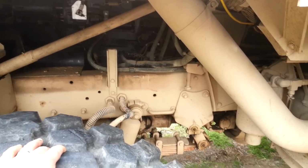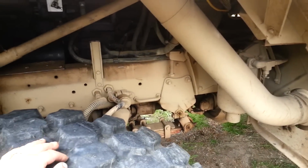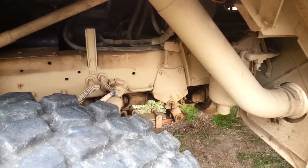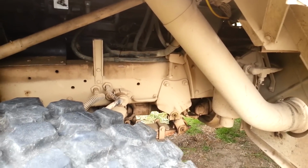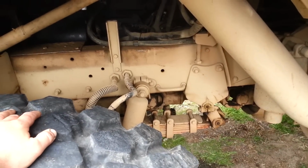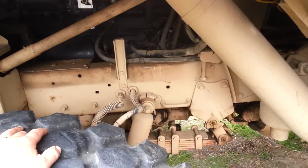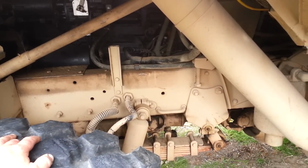Could still be a blown head gasket, and then that liner moved up and down slightly, which would wipe out the O-rings. But what was more fascinating is the oil pan was full of metal flakes, big ones. Some of them the size of my pinky nail, rolled smooth. I was sure it was coming out of that same hole, but I'll be danged.